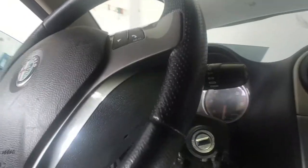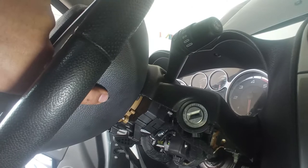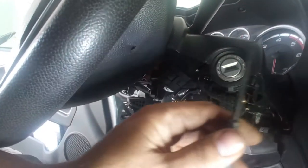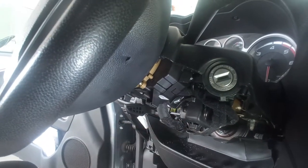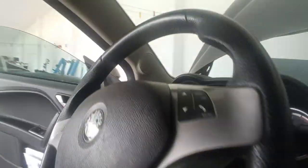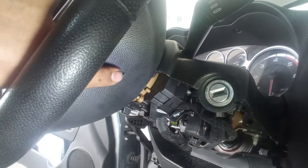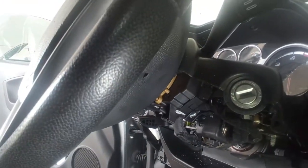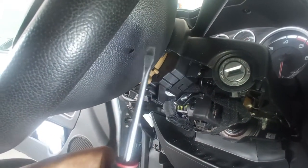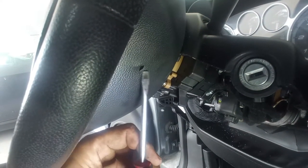Like on most modern cars, on the back side of the steering wheel there is a place to insert a tool. On PSA models it accepts just a punch, but on this car it's much more like the 159. Someone already took this out before — the holes are already open. They come closed from the factory and then you have to make a hole. You want to use a medium-sized screwdriver, get it in on this position, and work it along a path — you have to find that path.